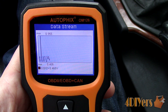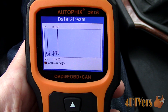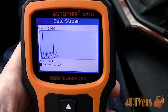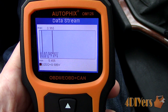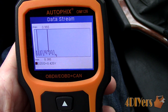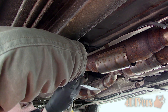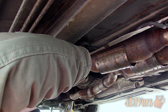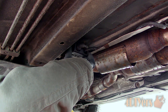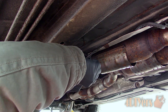As you can see, this vehicle is still showing a tighter range, but has spikes which can indicate unburned pollutants. This vehicle unfortunately does have an issue with the catalytic converters — I already know both are broken. This particular car does have a 4-wire system, which is quite common amongst most vehicles on the road today. Sensors originally started out with a single-wire system, then switched over to a 2-wire system, eventually having 3, and then some vehicles even having 5 wires now. Being that this vehicle has 2 different circuits, one for the heater and the other for the sensor, either can fail.